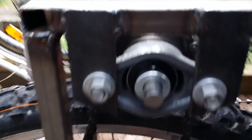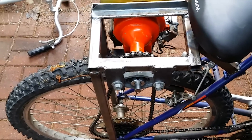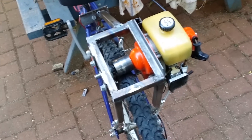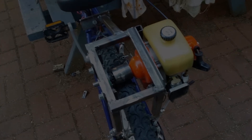In this version, the bracket didn't have that adjustable screw, so it was rigid. The downside was that if you mounted it that way, you were always pedaling — that didn't occur to me until I actually built it. The motor wasn't very powerful and the gearing wasn't right, so I played with the gearing, took out the sprockets, and went to a friction drive.